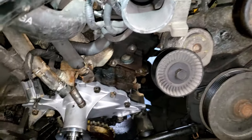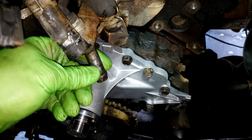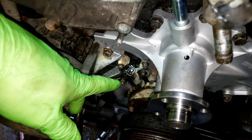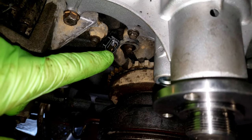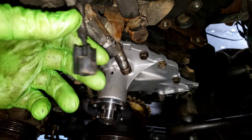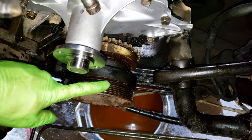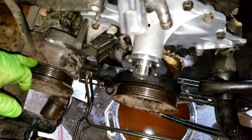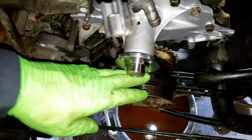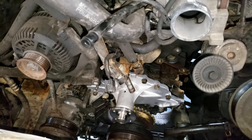Starting with this bracket — you might notice I also cleaned this off with some emery cloth, make sure you don't have any rust and pitting on that. If you see coolant in your wire connectors, like on this crank position sensor, make sure to blow that out. Not a bad idea to put a touch of dielectric grease on that connector. And spray things down with acetone too so you don't end up with a squealing belt. I'm going to be putting a new belt on this too, but wherever you got coolant, make sure to clean that off.